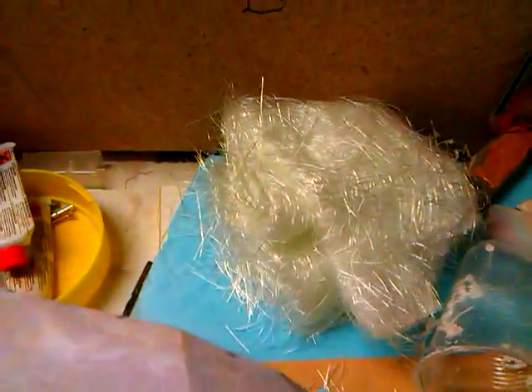If it doesn't, what I've got to do is put in this fiberglass mat — the woven stuff, which is a lot neater and nicer than the chopped strand mat. When I lay that on the inside over the top of the slush cast in there, hopefully when that sets hard then it won't budge at all.